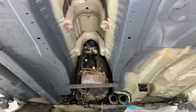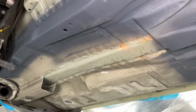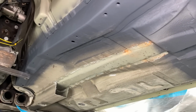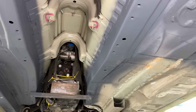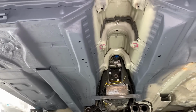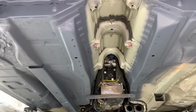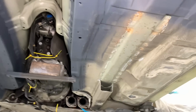It gets dipped, it gets all of the corrosion out, it comes back so that you can then deal with all the corrosion problems, and then it goes back for further dipping and then finally e-coating, and then you have to do the build up again, which requires full body paint outside and inside, and then an entire rebuild with new sound deadening. Those sorts of jobs are probably going to nudge into the late 5 figures, possibly could go into the 6-figure sums if somebody wanted one done to that sort of standard.